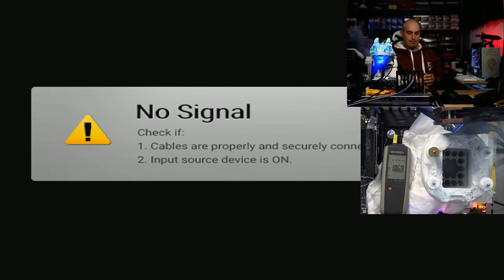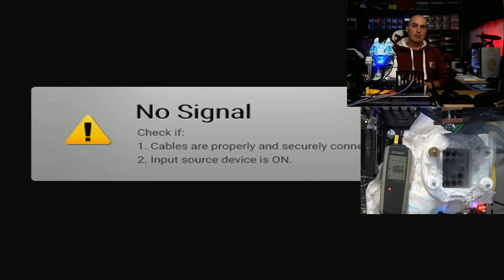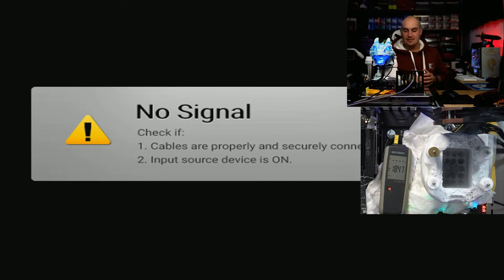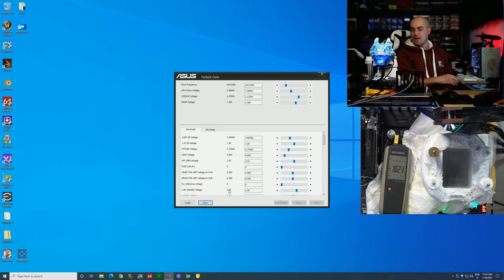Let's try at 32M. Let's see how it does, if I can pass 32M Super PI with that frequency. I think it's pretty nice. Maybe I can fine-tune the FCLK, I can gain like 33 MHz or one step, maybe. So maybe with a bit of work, I can improve a bit the frequencies. Yeah, it was really quick. This chip is a monster. It's super fast. But in my opinion, it's not the fastest in gaming, since I prefer the monolithic 5800X for gaming.